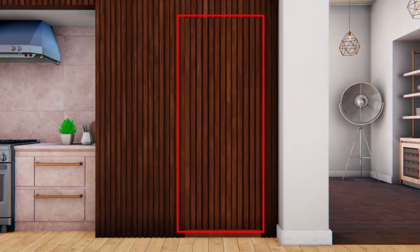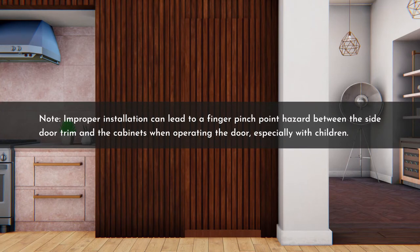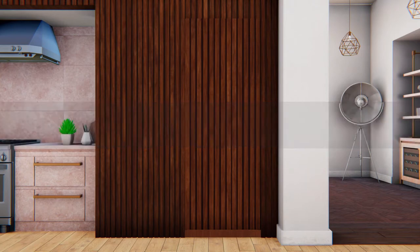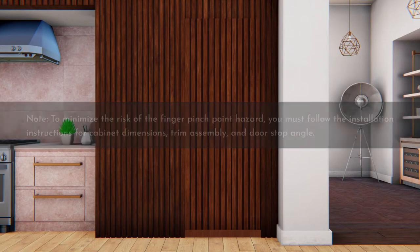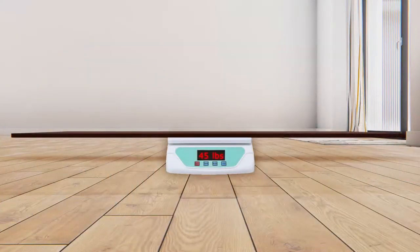To customize the appearance, you can install custom overlay door panels for providing a flush appearance with the surrounding cabinets. Note that improper installation can lead to a finger pinch point hazard between the side door trim and the cabinets when operating the door, especially with children. To minimize the risk of the finger pinch point hazard, you must follow the installation instructions for cabinet dimensions, trim assembly, and door stop angle.